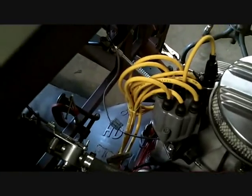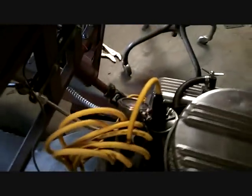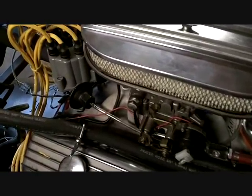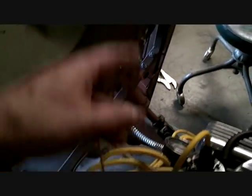All the little brass caps are on the plugs — on the plug wires. How come I don't have power? The one stupid thing I forgot: I need a lead from the ignition switch to the positive side of the coil, or else we're not giving the Allison or even the engine any power. I also need one that goes from the choke all the way up to the dash. Not too shabby — it's right here, on the other side.